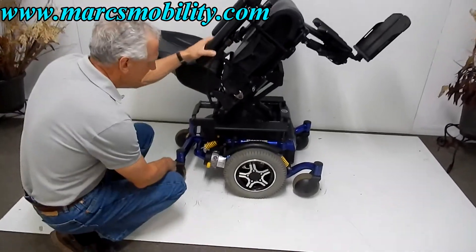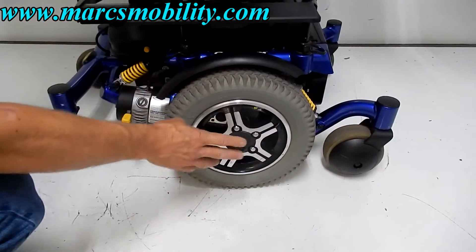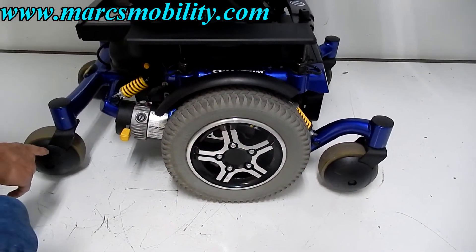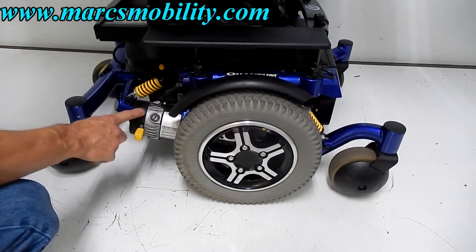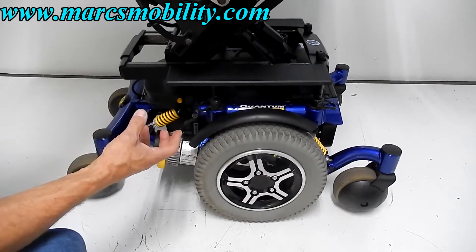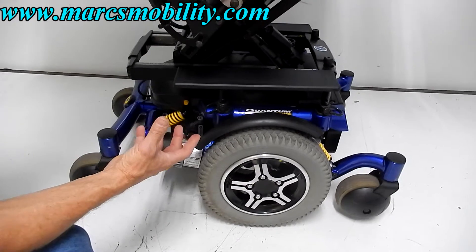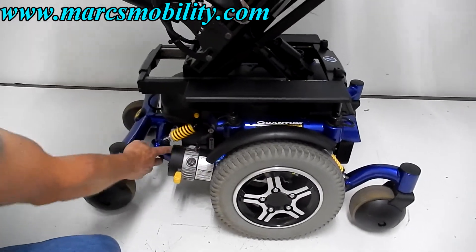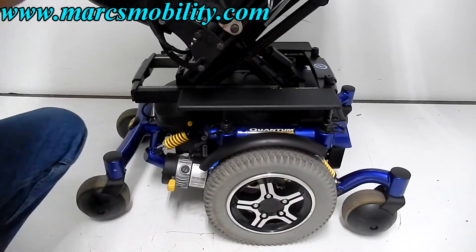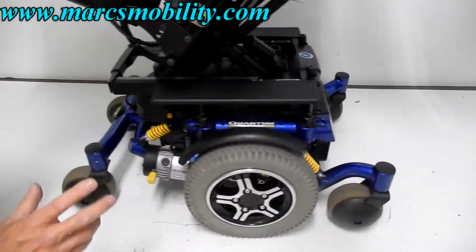Let's look at the bottom. These are 14 inch drive wheels, original tires from the factory with alloy wheels, caster wheels in the front, caster wheels in the back, and a heavy duty four-brush motor. You have four brushes around the motor, which makes it a little more powerful and a better quality motor. You have a great suspension with a solid frame — you can see the thickness of the frame, the suspension in the back, and the suspension in the front. So we've got suspension front and back, solid frame.